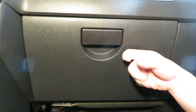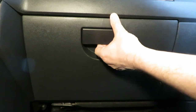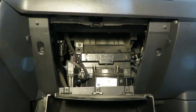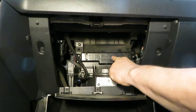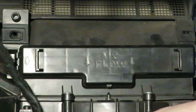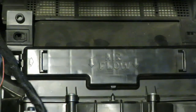For most vehicles the cabin filter can be reached through the glove box. They've made the glove box fairly easy to get out of the way to access where the cabin filter is located. Open your glove box and let gravity empty it out for us. Right in here is where your cabin filter is located — you can see the words 'air flow' on there, showing which direction the air comes in, from outside air down through the filter.